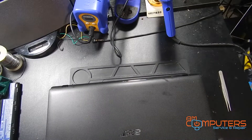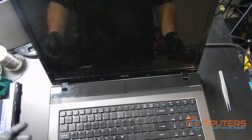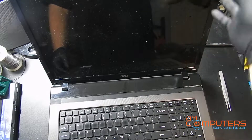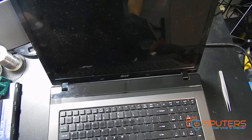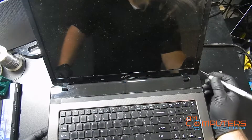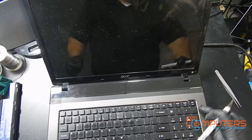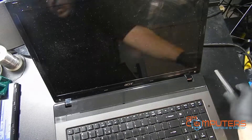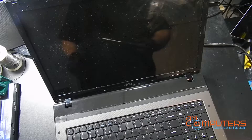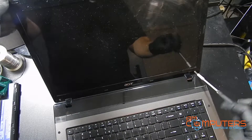So now this laptop has two little stickers, one here and one here. Behind those are screws, and I don't see any others. So once we remove those two screws, we should be able to pry this front bezel off and get to the screen. I'm just going to use a little razor blade to get in underneath these stickers — that's the easiest way. Now with our screwdriver, I'm just going to go in and remove these two screws.